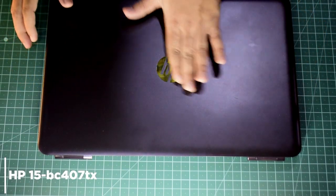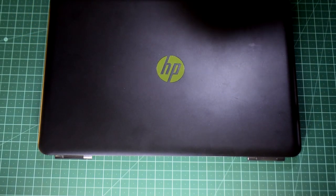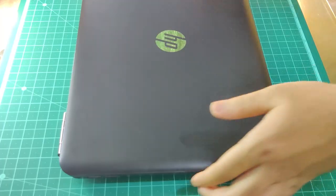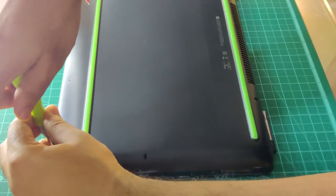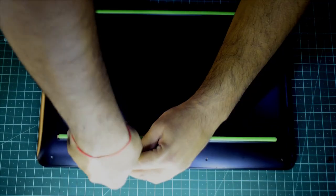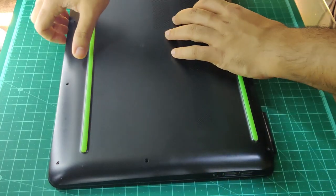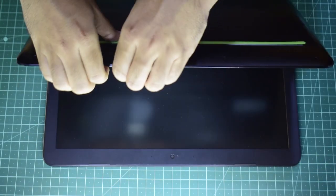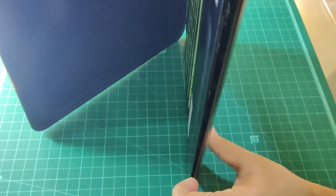This is my HP Pavilion gaming laptop. This machine is around two years old but still gives pretty good performance with gaming as well as editing. In this particular laptop the battery is not removable. The back cover is held in place by 10 screws along all of the edges, after which the back cover can be pulled off by detaching all of the clips along the sides.